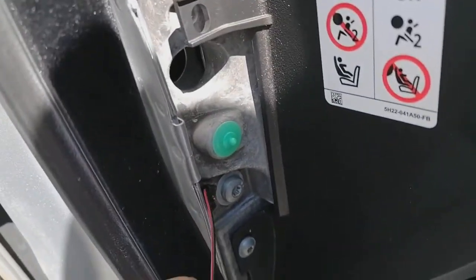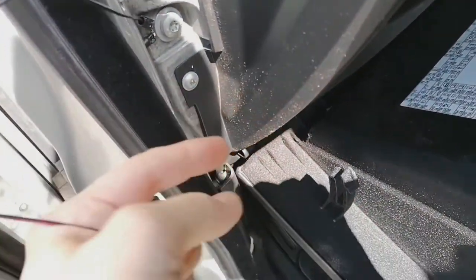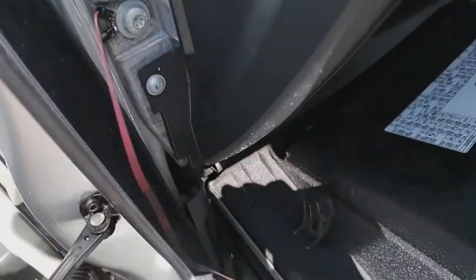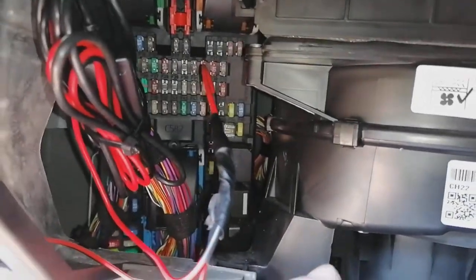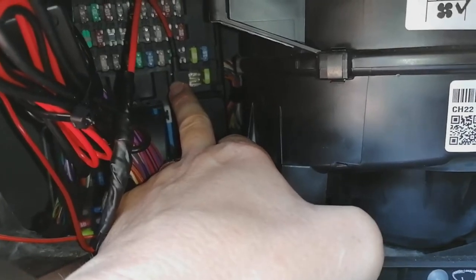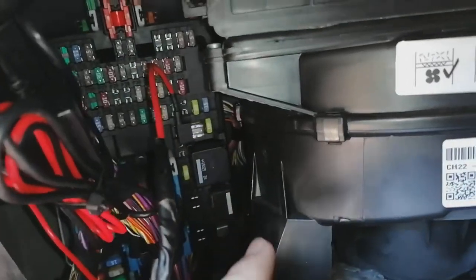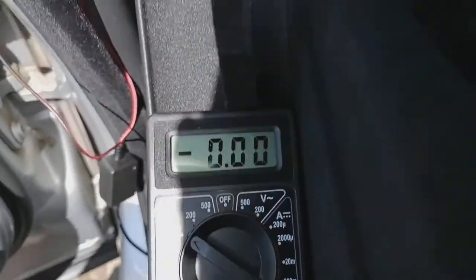There we go — there's our earth cable earthed behind the bolt, nice and securely. We're going to take the power cable through and behind and pop it out where the fuse box is. Here's the power cable that we've threaded through from the side. We've used this fuse here, which is a 20 amp ignition switch fuse, so the power goes on and off depending on whether the ignition is on or off — which is what you need. To test this you'll need a multimeter or one of those screwdriver test probes that light up when something's powered.